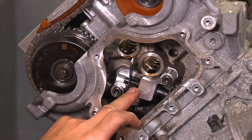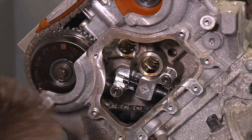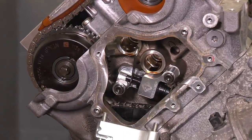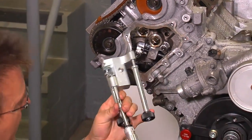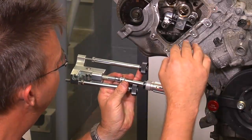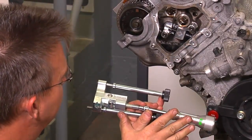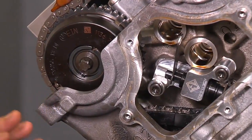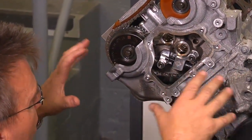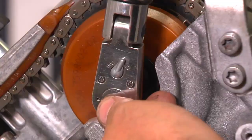Do not over-tighten or continue to tighten past the point where the gates can be installed. This small tool takes the place of the larger tool that sticks out really far from the engine, and also takes the place of the centi-newton meter torque wrench needed to set the preload on the chain — so only this tool is needed to replace those two items. This is very significant on some models when working with the engine in the car, since there are cooling hoses, cooling pipes, and wiring harnesses in the way of the larger chain tensioning tool.